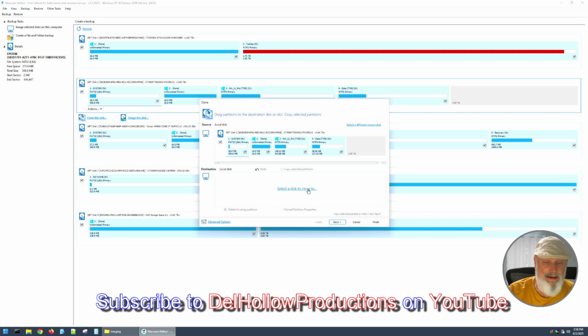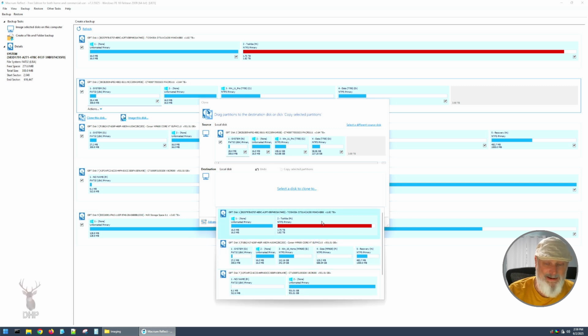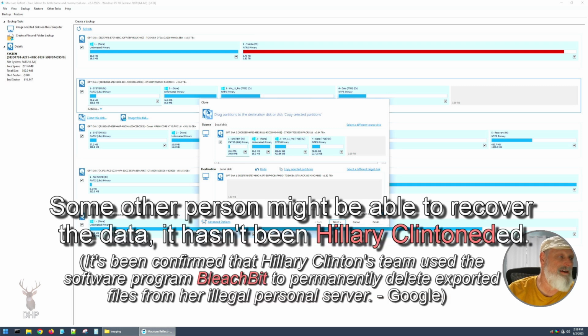So we're going to go down to the destination, and our destination is going to be this one that we call the Toshiba. You just saw us mount it, so we're going to pick that one. All right. And it's going to say, hey, dude, there's some stuff on this drive. You don't want to do this. We're going to have to write over it. Yeah, I'm going to have to delete the existing partition. I'm going to come over here and delete that partition. It's just gone. If I screwed up and got the wrong drive when I did this, as far as I know, it's just gone. Once you delete, you may be able to go into the partition table and try to reconstruct it, but I'm not smart enough to do that.